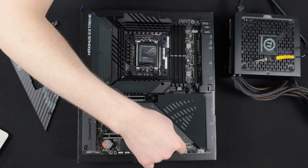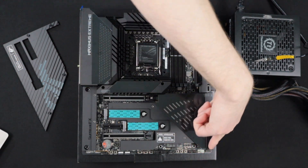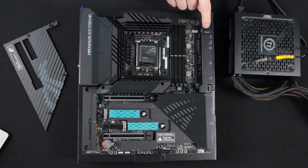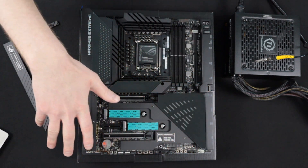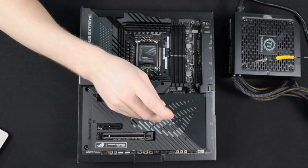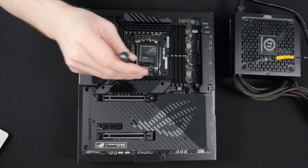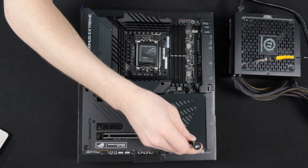You can go down and push these buttons, make sure that they click, and make sure that everything works as it should. Check down the sides at your connections as well. Click these buttons to make sure that they are also functioning as appropriately as you can tell. Now that we're finished with all of that, we're going to go ahead and replace the lower heat sink. I'm not tightening these tight at all — they're just set so that they're not going to loosen and not overly tightened so that they're going to cause any damage to the board.